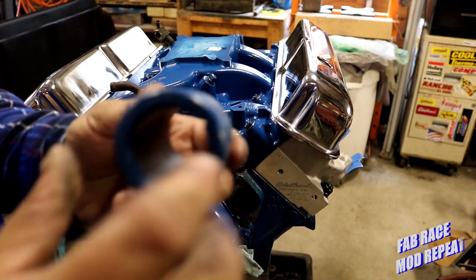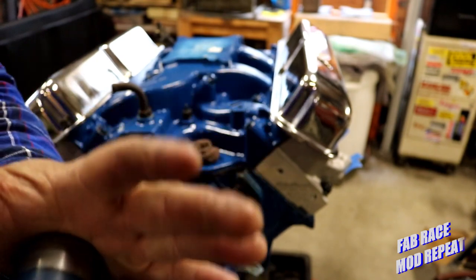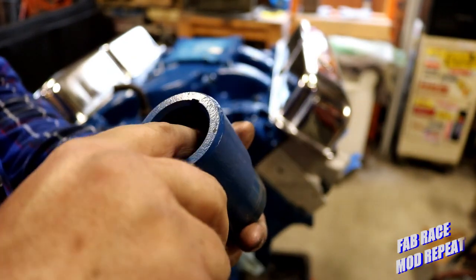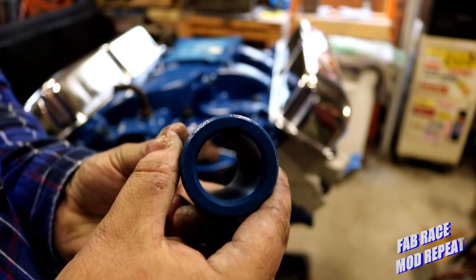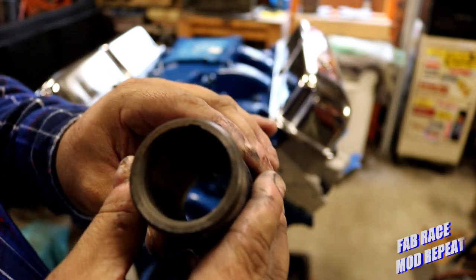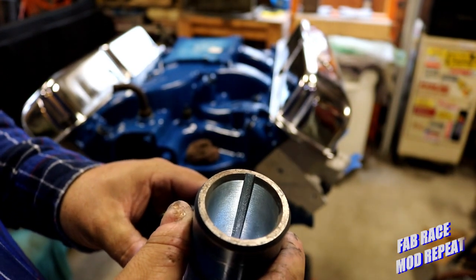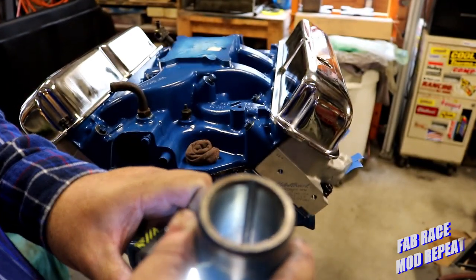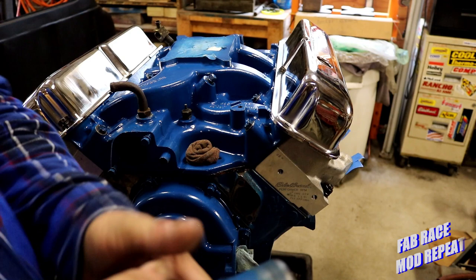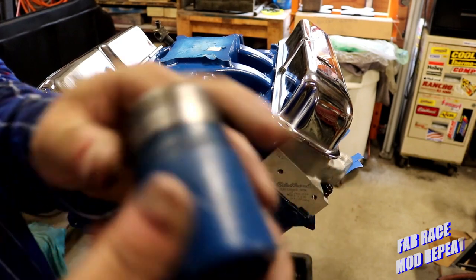What you want to watch for: some people hone these sometimes because they get damage in here on the keyway. Like I mentioned in the other video about the balancer sleeve — if the keyway gets banged up, some people drive these on and it messes the keyway slot up in here. See that keyway in there? If you mess that up, it can make it hard to put this balancer spacer on and off. People drive them on, they'll glue them on, they'll do all kinds of bad things to them. They'll beat the key up and then drive this thing over it and it messes that slot up.